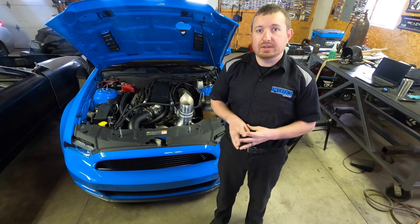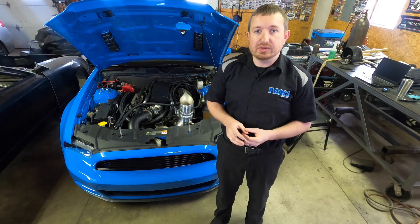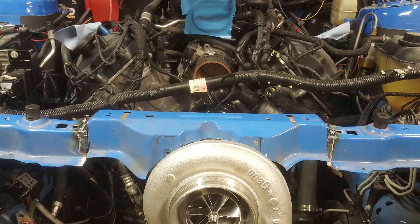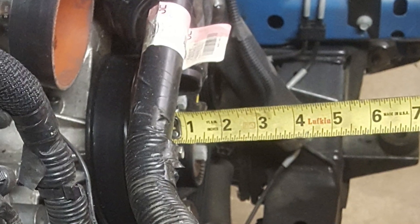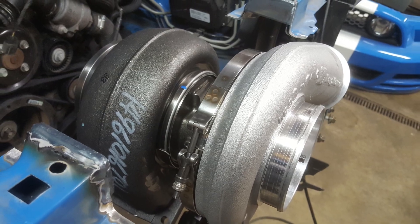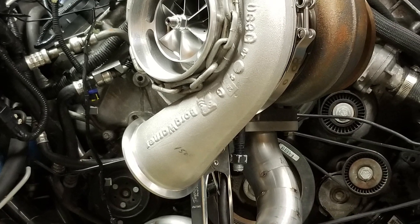Let's check this header out. Initially I had it straight up forward facing, but I wasn't able to put the turbocharger there because I just couldn't make the bend out of the downpipe. The five-inch diameter downpipe really limits your turn radius, and it was running under the water pump pulley. So we moved the turbocharger on a little bit of an angle to achieve the exhaust flow we're looking for.